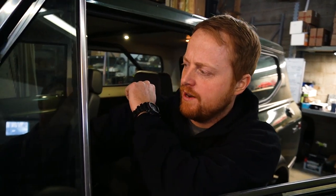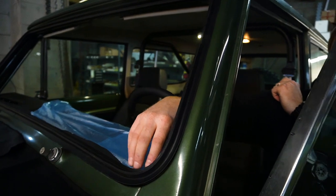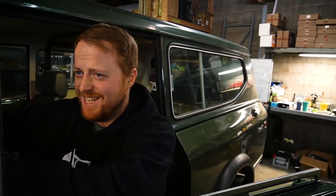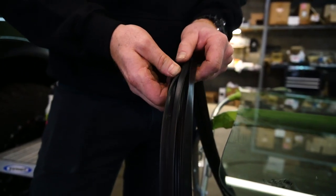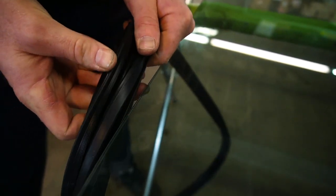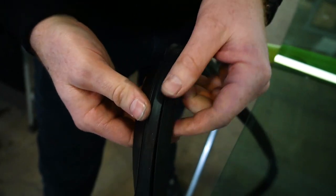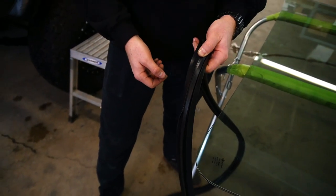The seal is on now. We've got a leather-wrapped dash in this truck and we're going to be using a little bit of soapy water to help get the seal in place around the glass, so I'm covering the dash pad to make sure to protect the truck. Now, this is the glass groove of your seal and we have this locking strip on the outside — once we have the glass in the seal, we're going to go along and fold that strip over and it will actually interlock into the seal and hold that glass in there nice and tight. You can see that the glass groove closes up real nice and tight when it's locked into place.